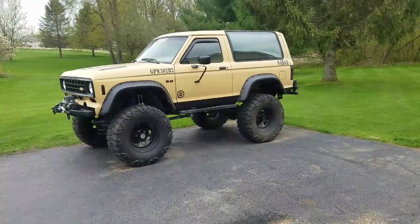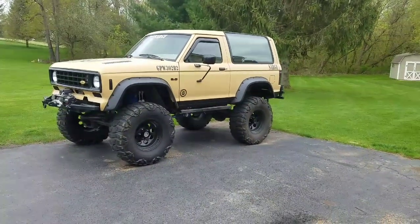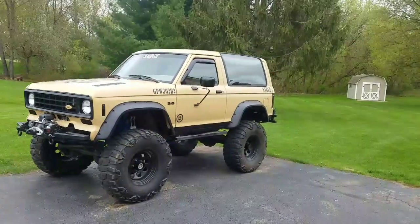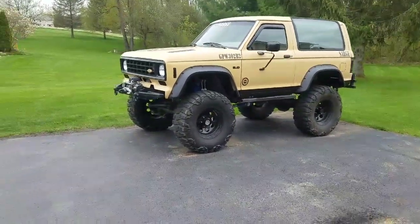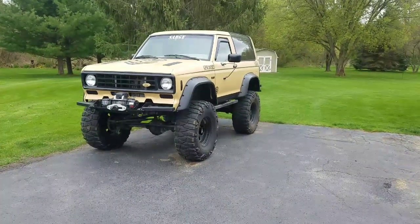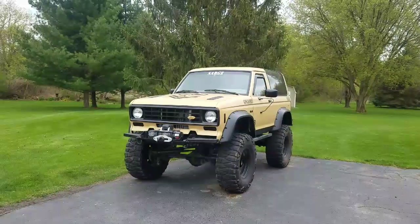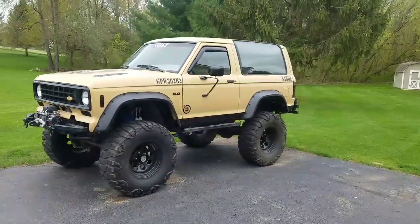At this point I had a 5.5-inch James Duff lift on TTB, 35-inch tires, 4.88 gears, and a modified Dana 35 with Dana 44 outers. Loved the truck — it did amazing. The 4.88s really helped the 2.9. The truck only had 47,000 miles on it, so the trans and motor were in great shape. The auto trans did give me one issue — an overdrive solenoid went bad. I changed that, did the other one as well, then did a shift kit with the valve body, stiffer springs, and some valve work.